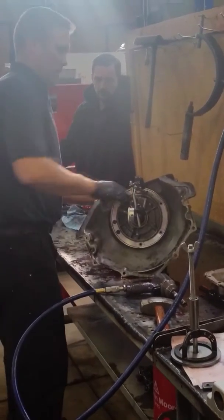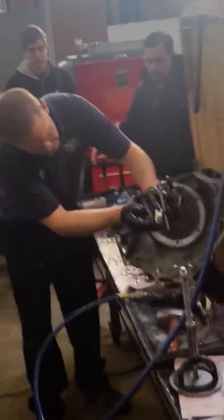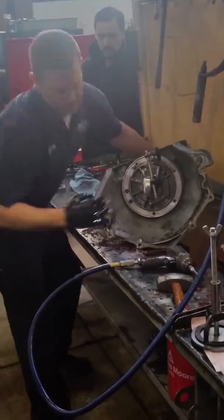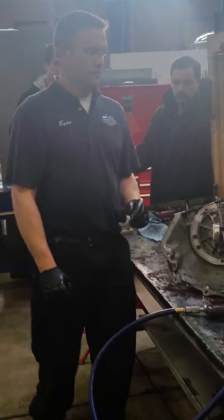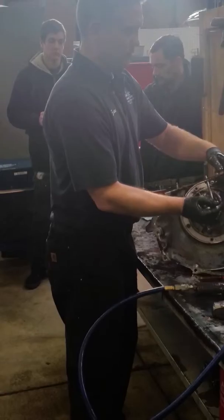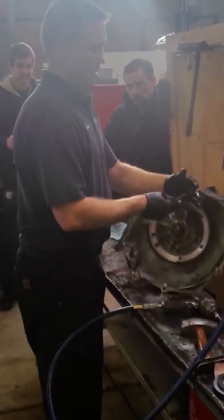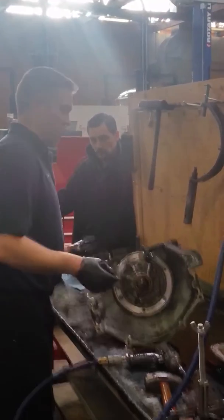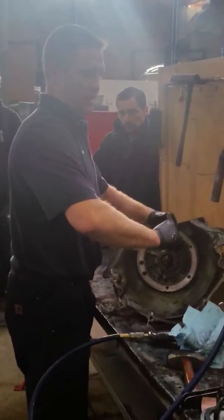Okay, so I'm going to attempt to push it all the way that way. Zero this guy, and I'm going to push it forward. And I had about 27 thousandths end play. Okay, so I know what I have. There's a specification for that. Off the top of my head, I think that's good. I think it's like 20 to 80 thousandths.